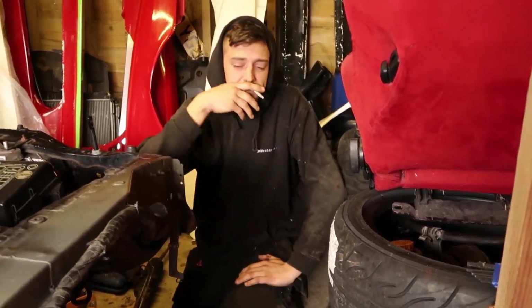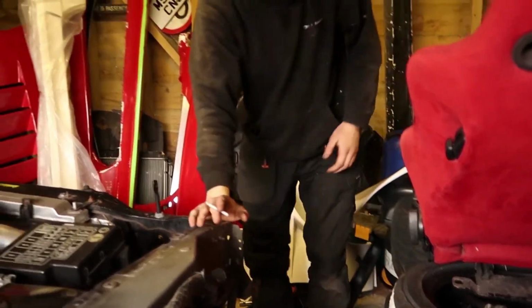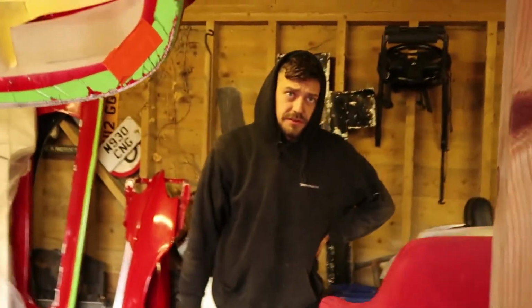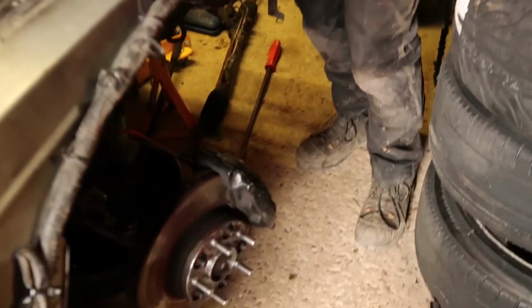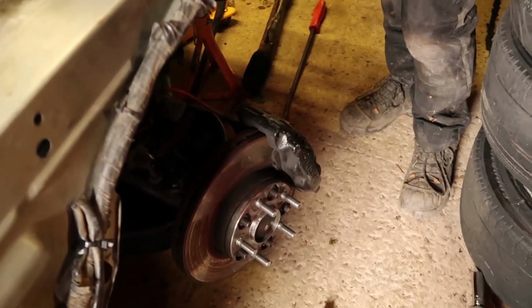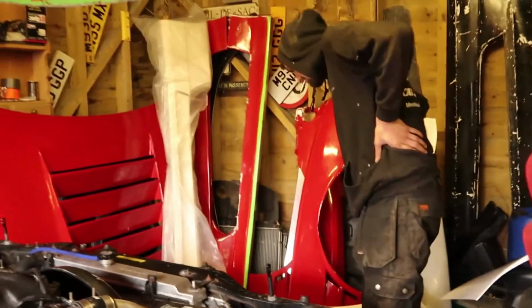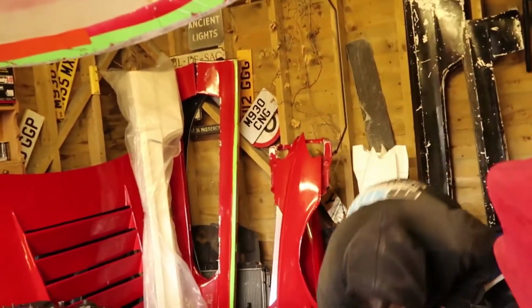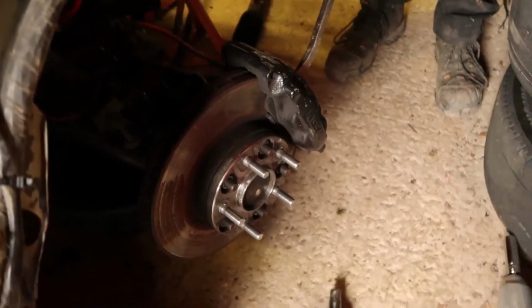I mean, you do run quite a lot of camber on the front. I do, yeah. So it's quite likely it has torn up the bearing. Well, stiff. Well, I think it was that side that the brake used to bind a tiny bit. And then at the tyre shop, we freed it up very quickly. But I'd never done more than freeing it up quickly before a drift day. That is why one of my concerns was the brakes might be a bit binding.